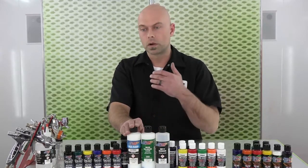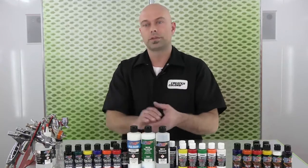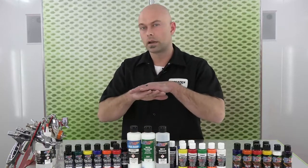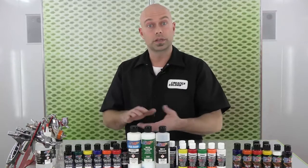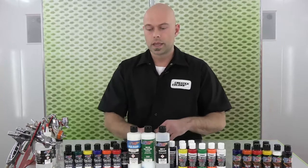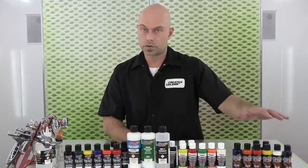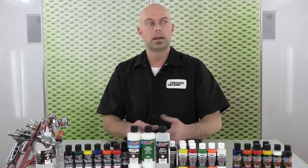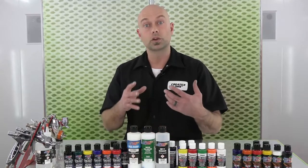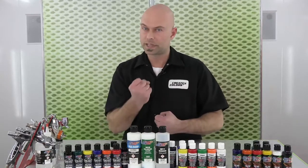The 4050 is better suited for heavier flakes, our larger pearl flakes, and metallics. It helps with the orientation of the metallic and with the actual film build — lets them lay down a little bit smoother with a lot less texture, which is very helpful for graphic work and tape-outs with multiple applications. Adding these two additives will make the Createx or the Wicked paint perform very similarly by creating an acrylic urethane, making them better in terms of mar resistance, scratchability, and overall bite.